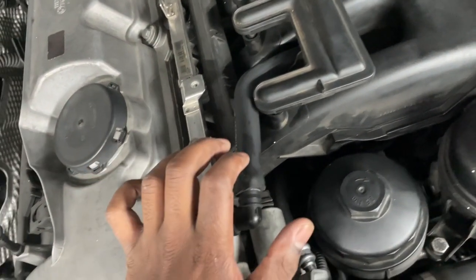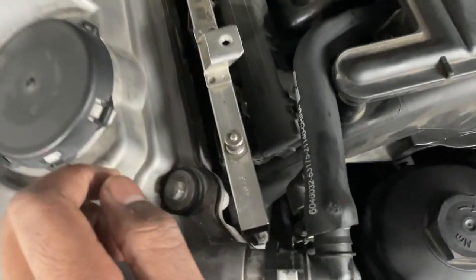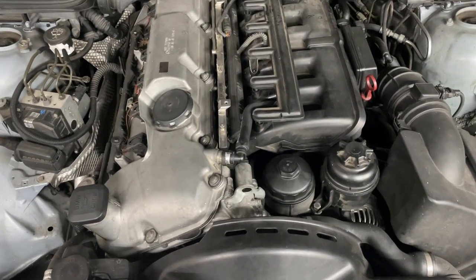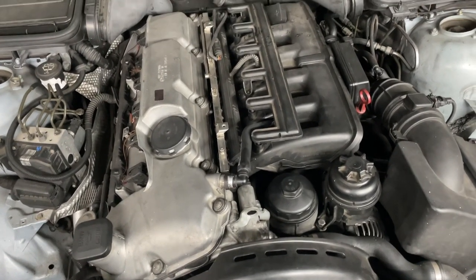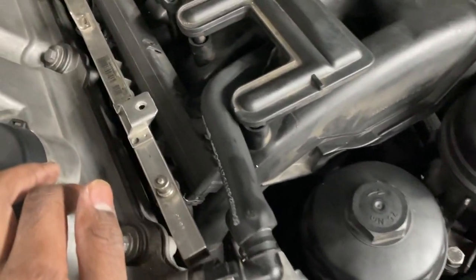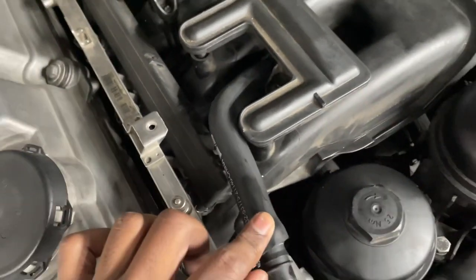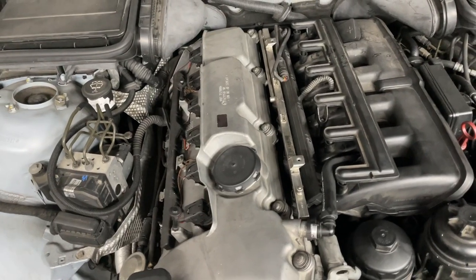For people who've already done the setup and are having the hose collapsing issue, I'm addressing it with this Dorman hose — I'll put the part number in the description. I bought it at AutoZone or online; it's pretty readily available. It's actually a Dodge PCV hose, and as far as I know it's not leaking anything and it's doing just fine, though I'd like a prettier solution and will probably buy a second one to dial it in better. But this works better than a collapsing hose.